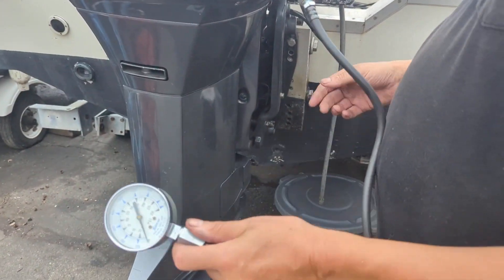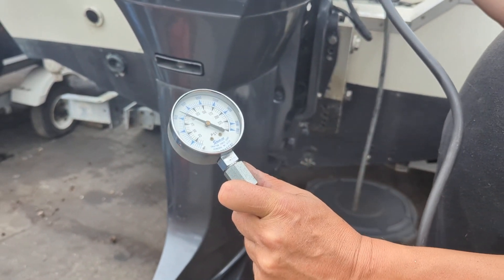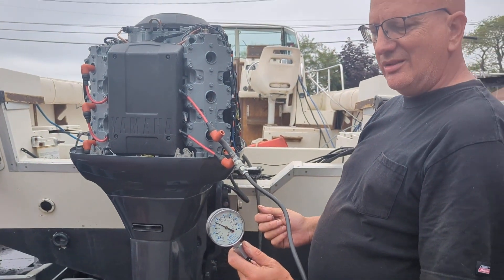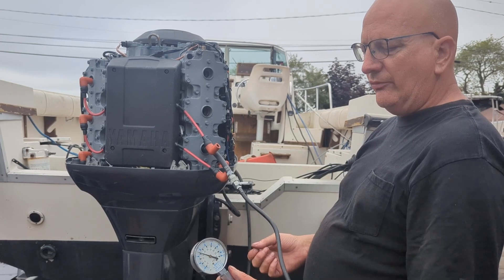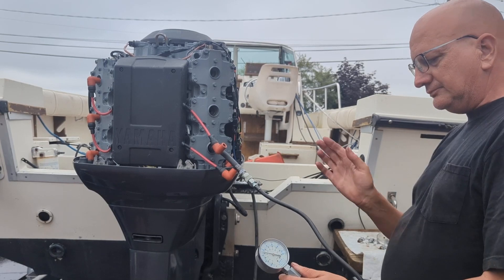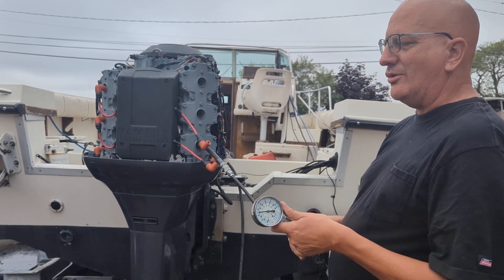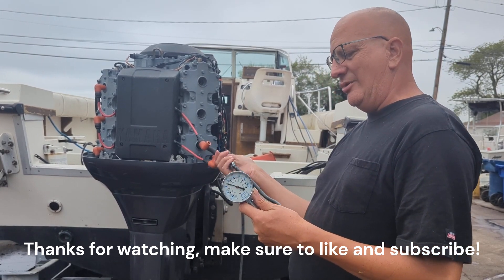Push the button to release the air pressure. That's it — all nice and even. Compression readings will vary not just by motor strength but by the strength of the starter, the strength of your battery, and the quality of your compression tester. If you buy a cheap compression tester, expect it to read 10 to 20% low, so it's not a good way to go cheap.